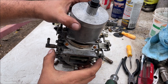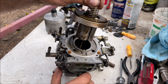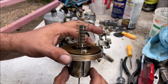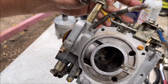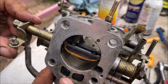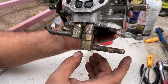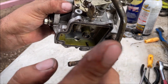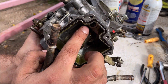What is under here? There's a little dipstick - just going to leave that alone. This piece comes out with a little bit of dirt on it - that's our main needle. The housing is machined aluminum, and this is brass - it's a heavy weight to hold the needle down a little bit. Be careful with the needle. You can see what it looks like on the inside. That's our main throttle blade, and notice we have manifold vacuum. These are your water lines cooling the air temperature, and also cooling the fuel in the bowl with water from the radiator.